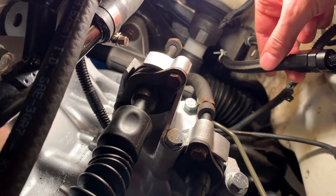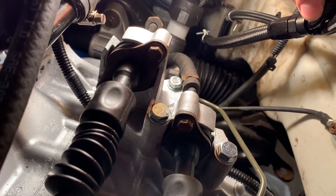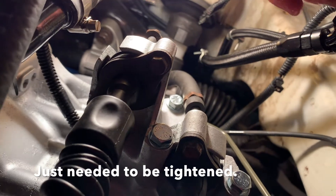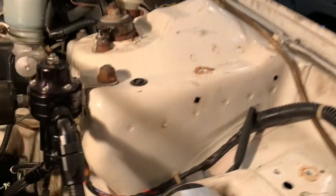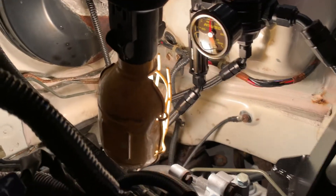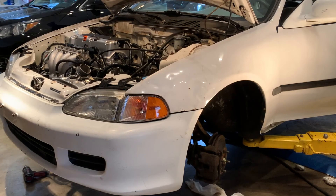You think it's still leaking? I just saw something drip - hold on let me move it around a little bit and see. Is it coming out? Yeah it is, it looks like it's coming out from in between. It is leaking bad. Okay we got everything dry and we're holding 50 PSI which is what K-Tune recommends. Take three. Take four. Everything is dry.